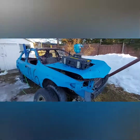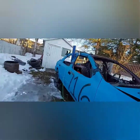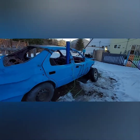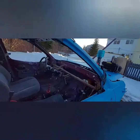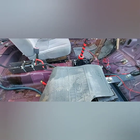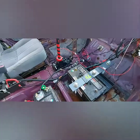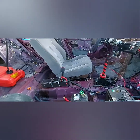This is where this video is going to end today — no go. I tried a different standalone harness and that didn't work out either. I'm thinking it's either my fuel pump putting out too much fuel pressure, or my computer is shot.